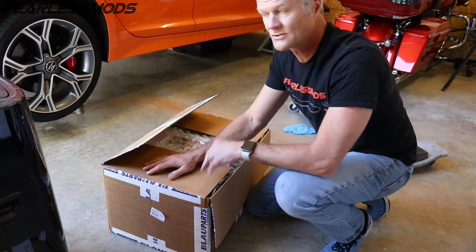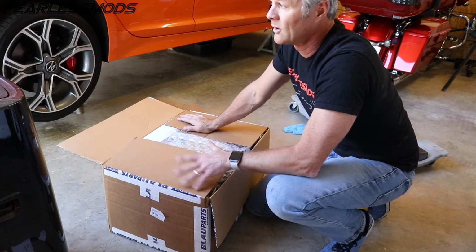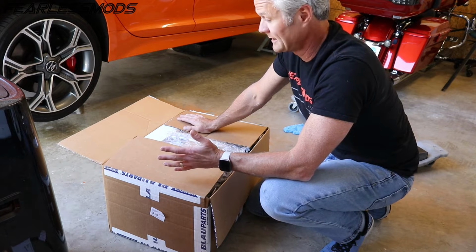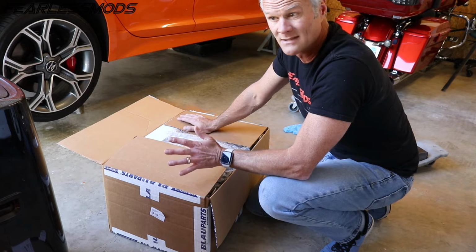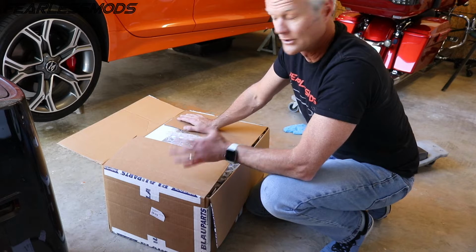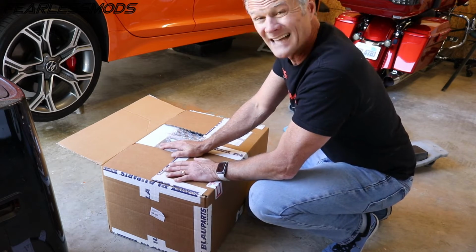So the next thing we're going to do, to get ready for replacement, is go in there and take out the drain plug. Okay, there's a really good resource out there. I'll put a link in the description below. In fact, it's the only thing I found on the internet that tells you how to check your fluid in these cars, or to change the fluid in the transmission of these cars. They're obviously a sealed transmission, not meant to be ever messed with until you hit the 60,000 mile point, and then you do this procedure, most likely at a dealer, and who knows how much that would cost you. I bought this kit from Blau Parts. It's not cheap.